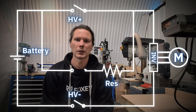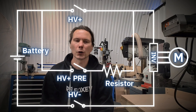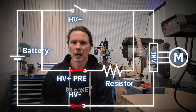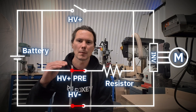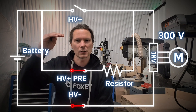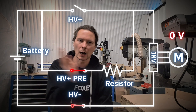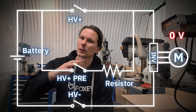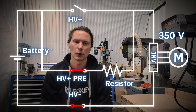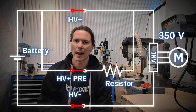If we look at the diagram from before, the way an electric car is different here is we've got a high voltage minus connector, a high voltage plus connector, and additionally a third one — the pre-charge connector — which goes through a resistor. What you do is close the negative side first on the high voltage bus, then close the pre-charge contactor. Through the resistor, the capacitors are gradually charged. You then measure the voltage gradually rising on the inverter side. By the way, if it doesn't rise all the way to the top, you know you might have a different problem — you can cancel the pre-charge procedure and not enable the car. If it rises all the way to the top, you close the main contactor, close the circuit, and now you can start operating the car. Every modern electric car does that.